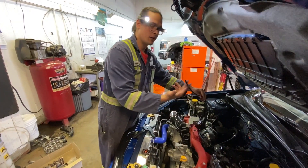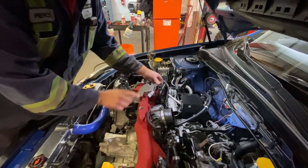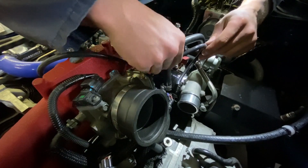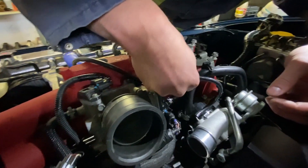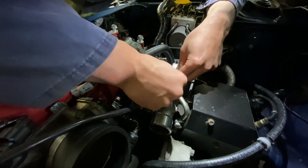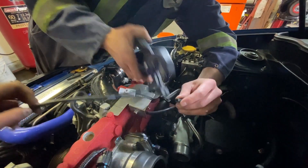They give you this four-millimeter hose, and since we're using the other one from the stock hose to come to our turbo intake, we just need two lengths of this. I'm going to put it in place so I know exactly how long it needs to be — this one just comes up and goes into port three. Now we'll feed this onto the wastegate nipple going to port two. Cut it a little long — you can always pull it off and cut a tiny bit if needed.